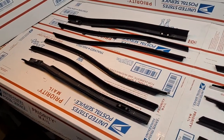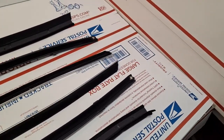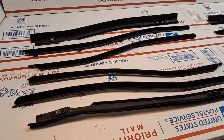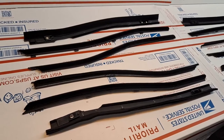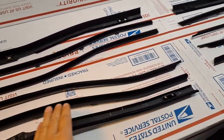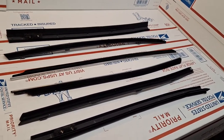For customers who have had trouble receiving the wrong product from suppliers providing the same seals across all years, I always make a point of asking everybody to identify their make and model and provide the correct geometry appropriate to the configuration of the vehicle. In 75-76, the rear window sweep seals have a very torturous curvature for the rear quarter window, as opposed to 71 through 74, where they're substantially straighter, although still curved.